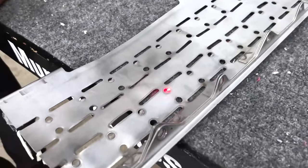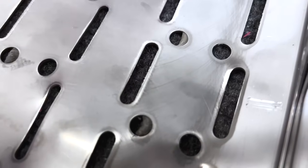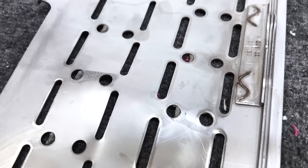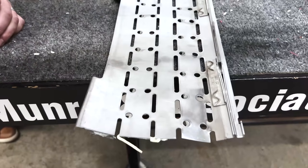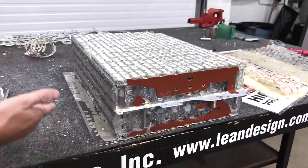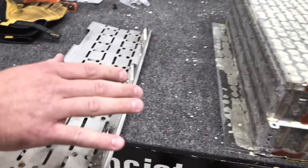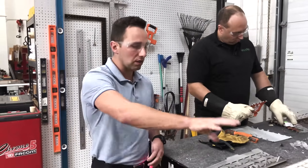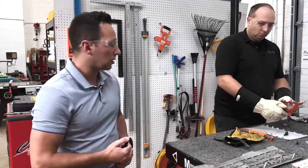You can see some of that adhesive starting to squeeze through right here on the side shield. In the sheet metal world — GD&T, geometric dimensioning and tolerancing — these slots are your two-way locator. It's a vertical alignment of this side shield relative to the two segments of modules separated by the cooling plate section. A lot of effort went into indexing this thing vertically and making sure it's positioned relative to the Z height or vertical position of this module as it's installed to the vehicle.